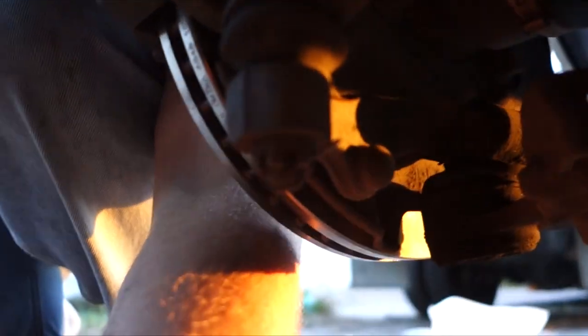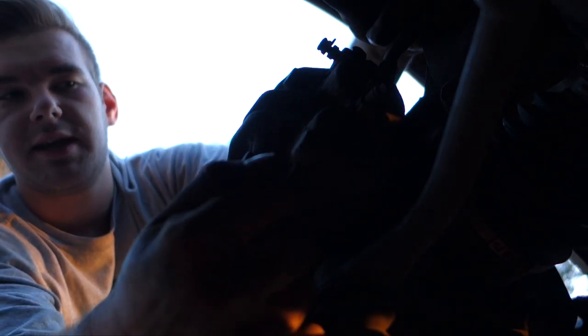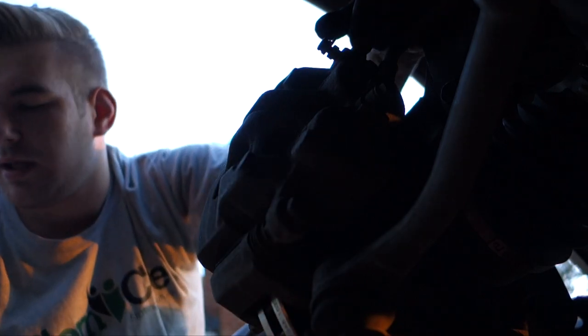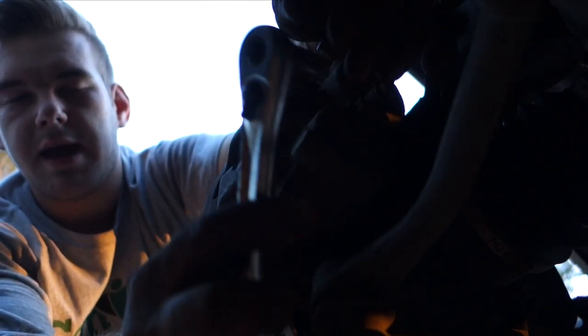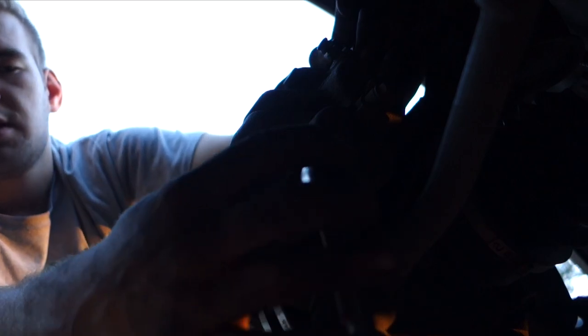On this vehicle, it only has two bolts that actually hold the whole piece together — we have this bolt and we have this bolt to take out right here. These are the only two bolts we are gonna take out. We will need a nine-sixteenth socket — a nine-sixteenth will go on here and we're gonna unscrew this right now.